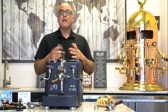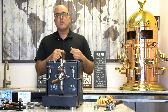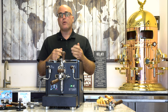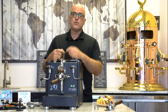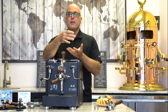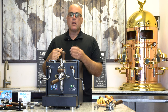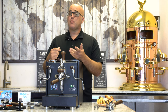Now I'll get to the feature we suggested to Torre to bring them to the forefront and make everyone else obsolete. One problem with smaller dual boiler machines is that you have two boilers and two heating elements, and typically the steam boiler is smaller than heat exchange boilers. We advise customers that when using the hot water wand for tea, you typically need to maximize the exit of water at about four ounces, because if the water level drops too fast before the pump refills it, the heating element on the bottom can be exposed to air and crack.